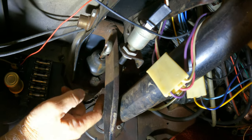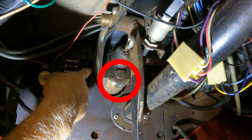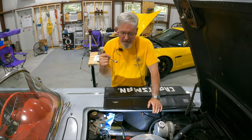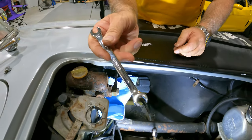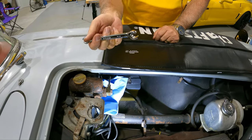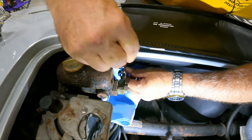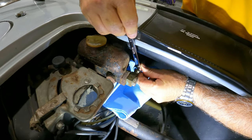Now what we're going to do is go up to the top side and pull these bolts that are right around here on the back side. We'll pull those out and then pull the master cylinder out and swap the new one in. I'm going to loosen this nut here, which is a 7/16. I've got the flare nut wrench — for those of you that don't use those and use an open-end wrench, buy these. They're designed for this to help keep from tearing up the threads. I do have the blue towel underneath it so that it drips a little bit, which it probably will, but all the lines are empty.